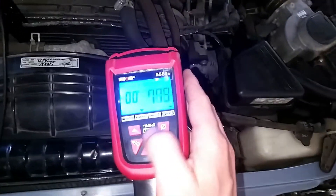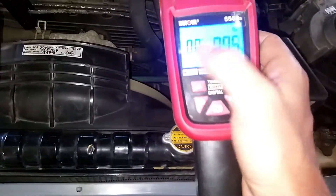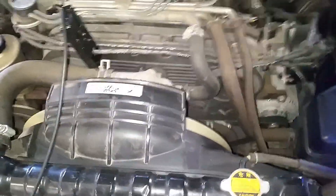There you go — 10 degrees. As long as you don't move these buttons, you're just seeing where your timing is at. If you move them up or down it'll move closer or further away from TDC and you can verify timing. That is a real simple ignition timing check on this 1990 Toyota pickup. Like, subscribe, share, and hope I'll see you on the next one.